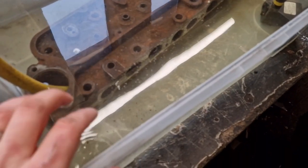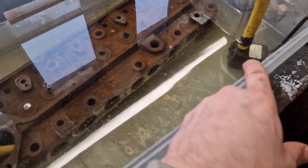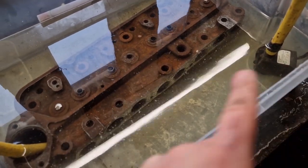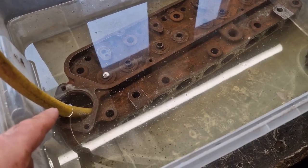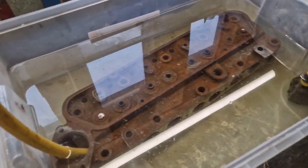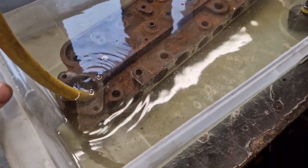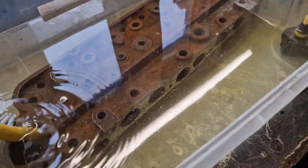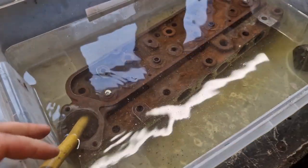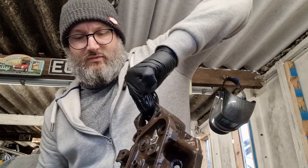It's a really good method - if you've got anything like this you can put it in, go make a cup of tea, get on with some jobs, come back and hopefully we've got a clean cylinder head. It took a bit longer than I thought but the temperature is a comfortable bath. As you can see it's all set up, and to keep it agitated I've got a small pond pump here. I've put it on the thermostat housing area so it'll draw in water, push it along the hose all the way around, and keep moving through the head.